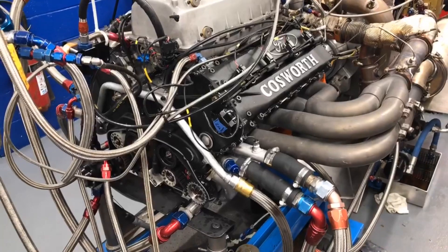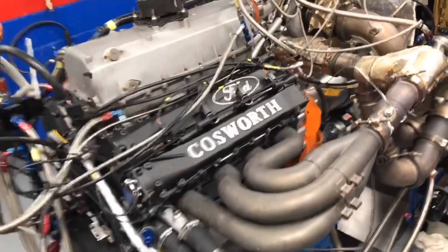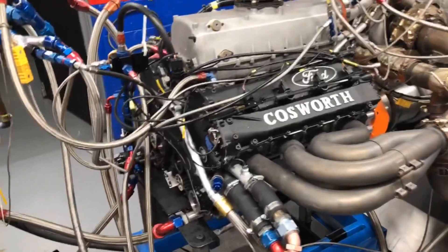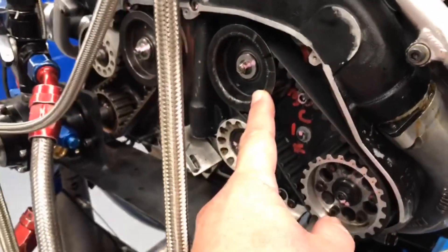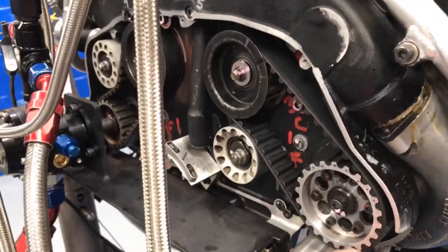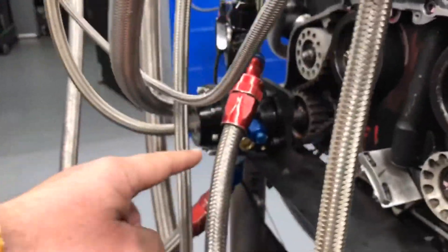The rest of the engine is fairly standard by today's standards - a four-valve quad-cam V8, single turbo, 2.6 liters, roughly twice the displacement of a Hayabusa but in V8 form. It has all this gear drive assembly on the front; you can't even see the front of the crankshaft. We had to mount a trigger wheel on a drive running at camshaft speed to set ignition timing. These assemblies drive oil pumps on each side, and a small drive mechanism runs the mechanical fuel pump on the engine dyno.